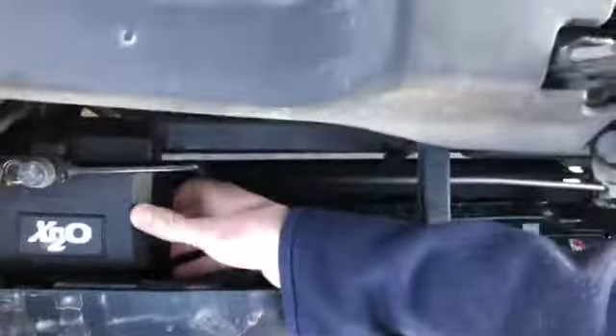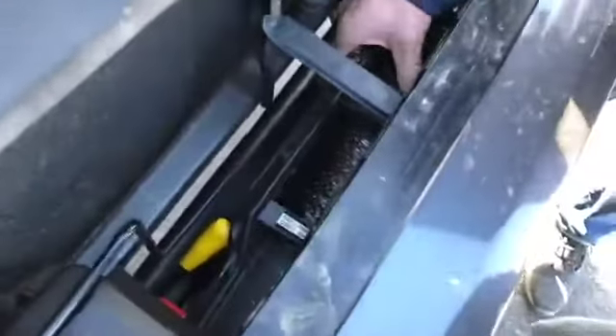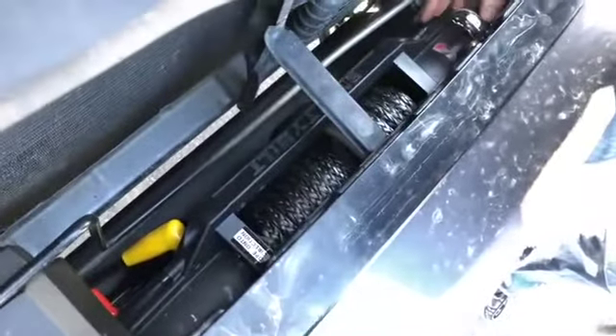There's the solenoid. We had to make a new bracket for it because it didn't fit — we'd have had to cut out this much of the bumper. And here's the winch — synthetic rope, so it's about 40 pounds lighter than the regular. And how you engage and disengage it — on and off switch right there. And that's pretty much it for the winch.